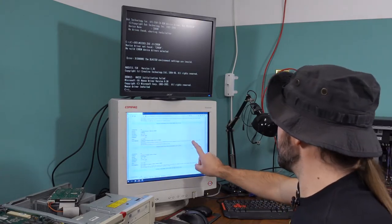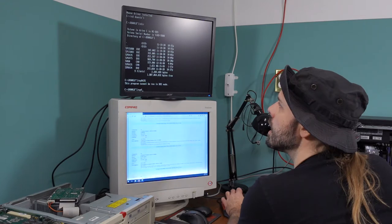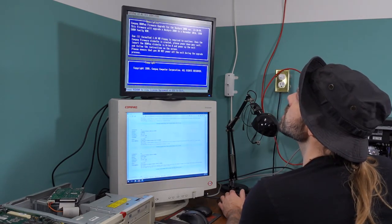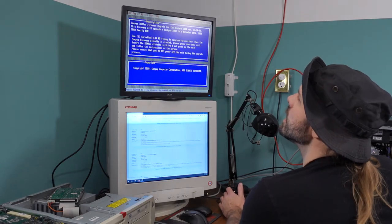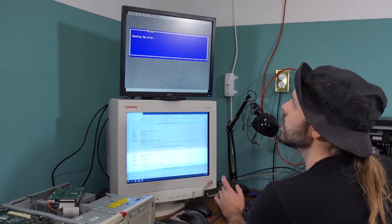Okay, so I found a download that says it's for the Deskpro 586M models, and it's from 98 as opposed to 97, a year later. It says 586M, so it should have no excuses now. It's SP8434. There it is, yes, 586 ROM, version 12.10.98. So yes, theoretically this should upgrade our thing. Page down, agree, A, burn it to disk.